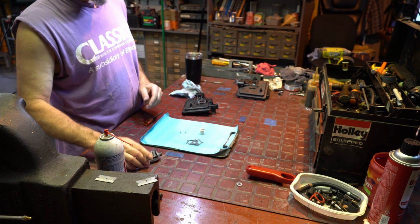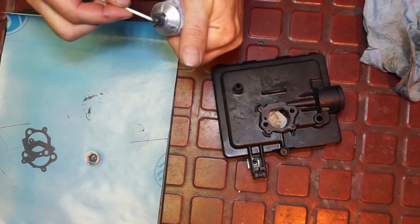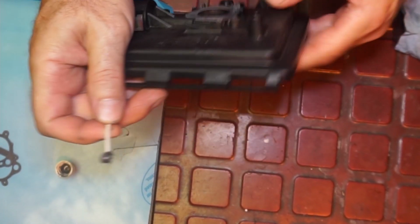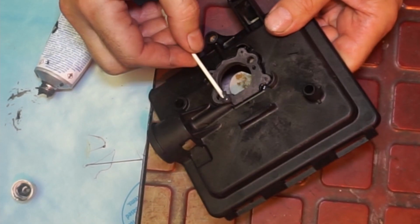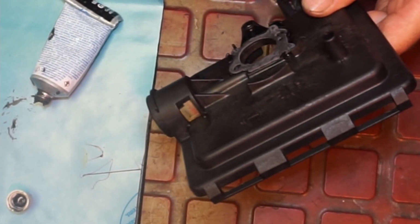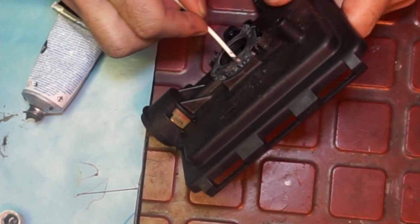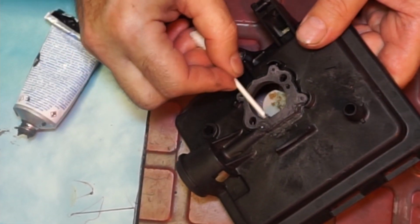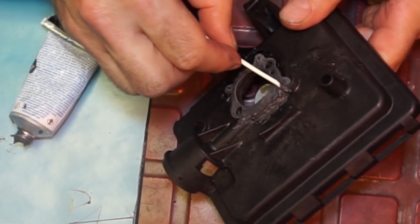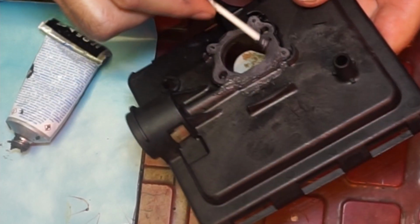All right, now that we've done that, we're not done. All right, still take a wad of RTV, you know, decent amount. Enough to get something on the tip like that. And there's two places we really want, or three. There's a gap right here. We want to cover that, and then we want to backfill this entire bottom trench. Just like that. And make sure that you've completely filled it. And don't worry, just make it smooth.